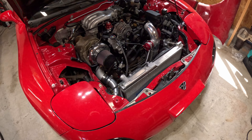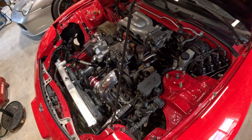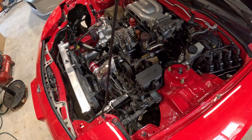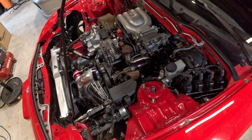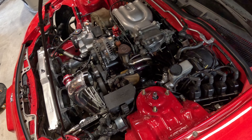No time but the present. We have started pulling the car apart — we got the elbow off of the throttle body and intercooler pipe, and that gave us all the access we need to reach down to those spark plugs. If you watch my Rotaries Are Awesome video, you'll know that there are two spark plugs per rotor. That's right, we have a leading and a trailing spark plug, so that means we're swapping out four plugs today.